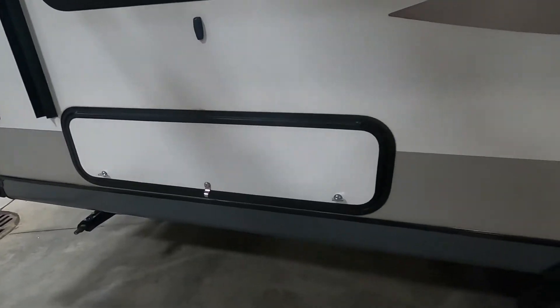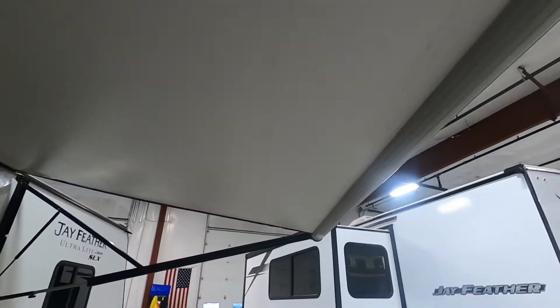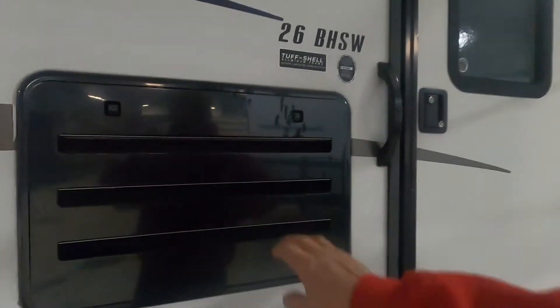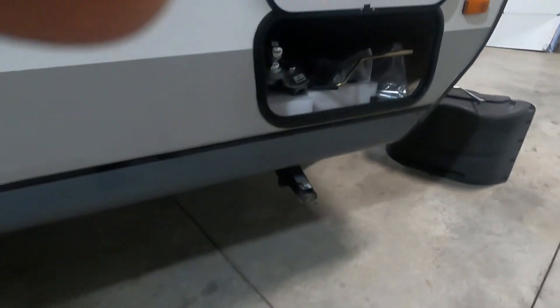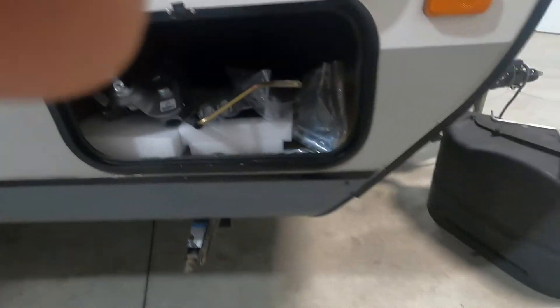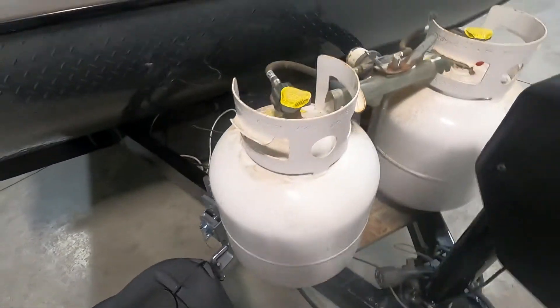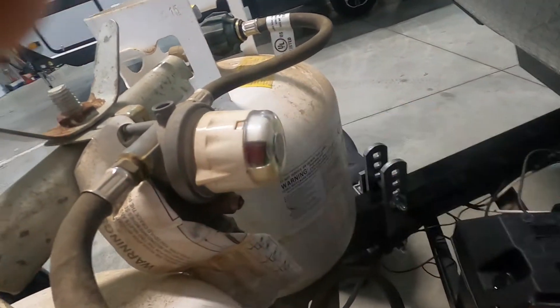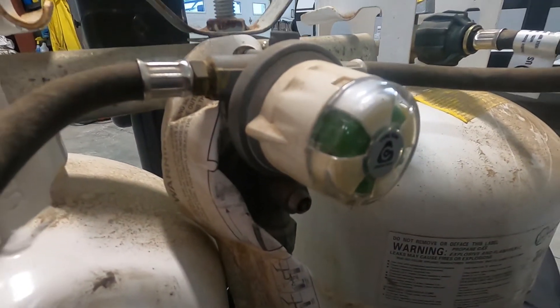All right, we're all hooked up to camp. Let me walk you around the outside of the unit. Starting here on your camp side, you have this big storage area, your potable water fill, outdoor speakers, and your big awning. Remember, you only want to run this awning out until the flap falls down to 90 degrees. This is access to the back of your fridge, the 110 outlet, and your stabilizing jacks. Over here is storage with all of your hitch work in it. This is a cover for your propane tanks — you have a regulator here; simply point it toward the tank you wish to use. Lefty-loosey to open, and it'll turn from red to green. Green means it's full; when it turns red, it's empty.